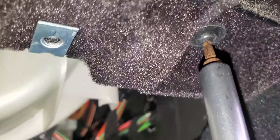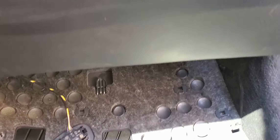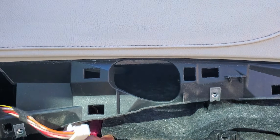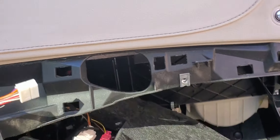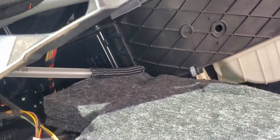The other one is right here, still holding the glove box in. Let's go ahead and loosen this out. Remove that last screw that's underneath. Now we're going to go ahead and just pull this glove box out. It comes out like this, and we have access to the hose — which is right there — which is part of your air freshener system.